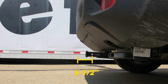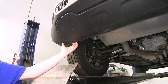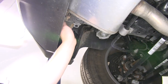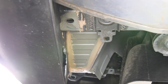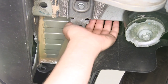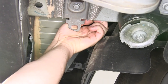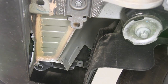That'll complete our look at the hitch. Let's show you how to get it installed. We'll begin our installation underneath the vehicle on the driver's side at the back corner. There's going to be some plugs in the frame rail that we're going to need to remove. There'll be one located on the bottom at the back of the frame rail — you'll want to pull this plug out. And there'll be two located on the outside: one towards the rear of the vehicle and one slightly towards the front. We're going to need to remove the one that's towards the front of the vehicle. We'll just pull that out and repeat the same process on the other side.